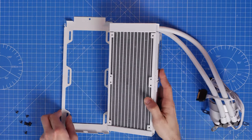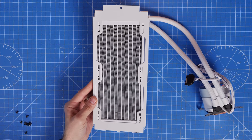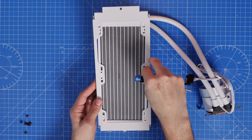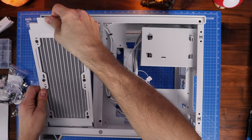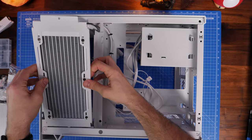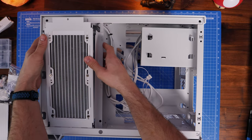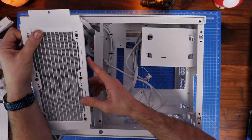I'm using intake fans with reverse blades to pull cold air through the back of the case, through the radiator, and into the case. I think this is preferable because it keeps your CPU running cooler - I've done a guide on the best places to mount your all-in-one cooler with performance testing. For mounting the radiator, the logic is to put it on and then install the fan bracket on the rear. I found it can be a little tricky to get back in as it was being blocked by the side panel, and this is quite a thick radiator with thick fans.